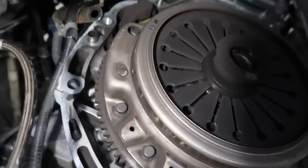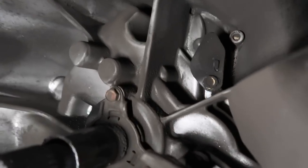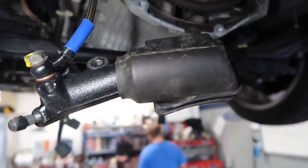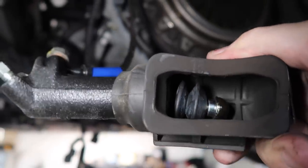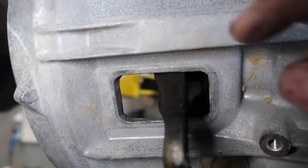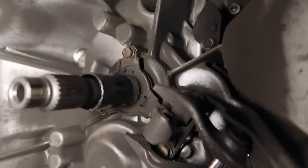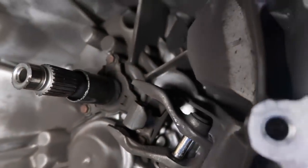The clutch is exposed — you can see a lot of material worn off the bearing, so it's probably close to worn out. He has the rebuild kit, which includes the slide, the seal behind the slide, and the main seal behind the flywheel. People often ask if they really need to replace the boot. You don't unless it's damaged, but they harden and crack over time, which breaks the seal on the transmission side. Clutch dust and water get on the shift fork and turn into a sludgy mess that can cause the clutch to stick — that's why we include the boot cover in the rebuild kit.